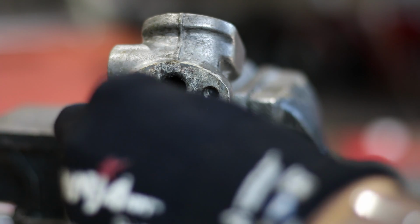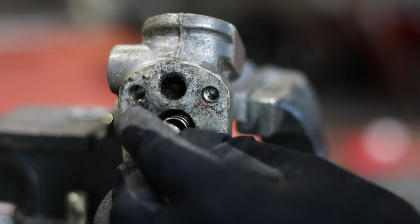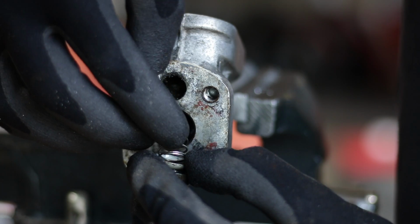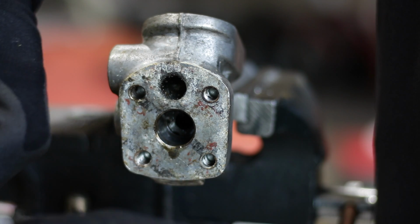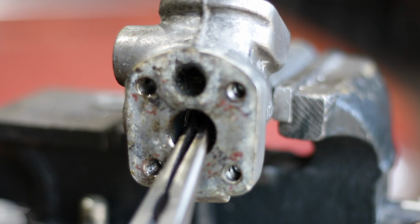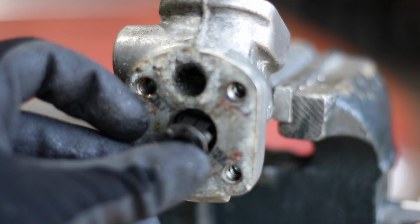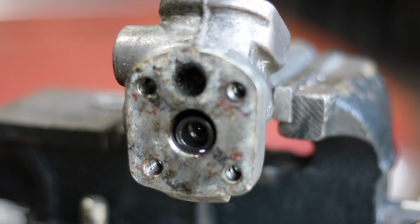Inside the cylinder, there are two sets of seals and springs for the two different chambers. The low pressure side, which opens and shuts the air valve, and the high pressure side, which amplifies the brake pressure via the big vacuum diaphragm. There's a little clip that holds the parts of the high pressure side back.